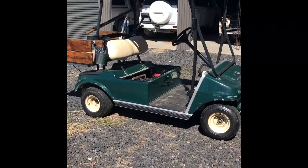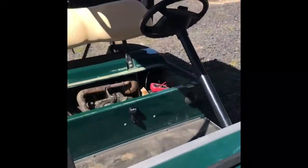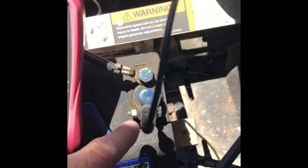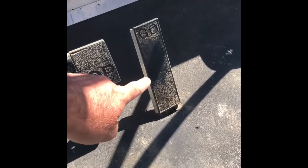With any little petrol-powered cart, this is the first thing I would check, and that is your battery. To check it under load when starting, get your multimeter, put positive and negative on the correct terminals of the battery, switch it to volts, and test it there — but then also test it under load by depressing the throttle.